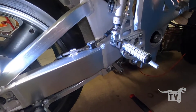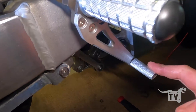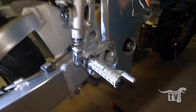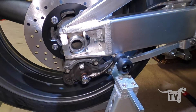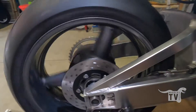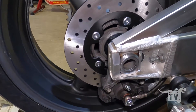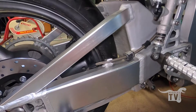The system is all complete and working. I have a little bit too much movement in the brake pedal, but I'll look into how to resolve that later on. Everything is all mounted in place. When I spin the wheel, the brakes actually come on — which is a bonus, as we didn't have that earlier today. New pads and new rotor, so it might just take a little bit for everything to bed in.